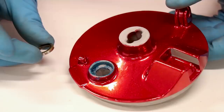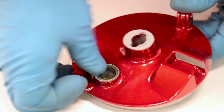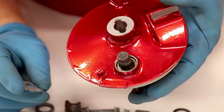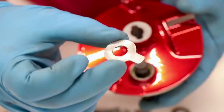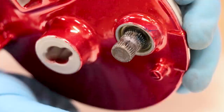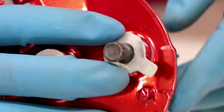We've got the brake shaft — you want to get as much grease on there as possible — and this goes through the back side. Next up we have this little plate that goes on the shaft; the arrow faces outward. On the splines of the plate there's a little notch, and that notch lines up with the notch on the shaft. You'll notice on the top of the shaft on the splines there's a notch — we're gonna line those up just like that.